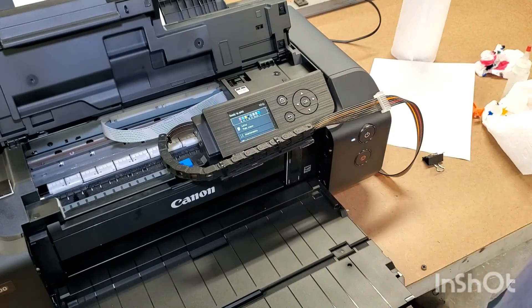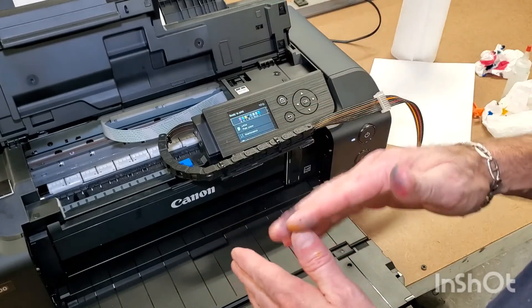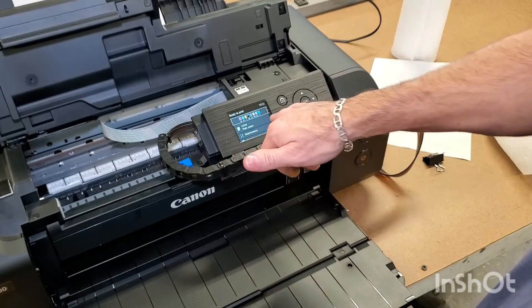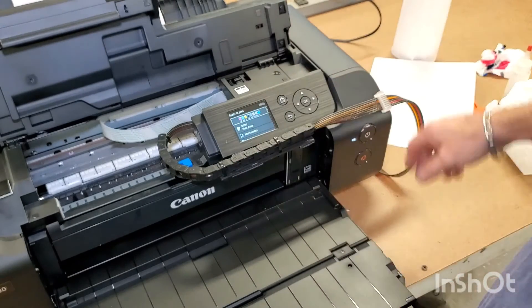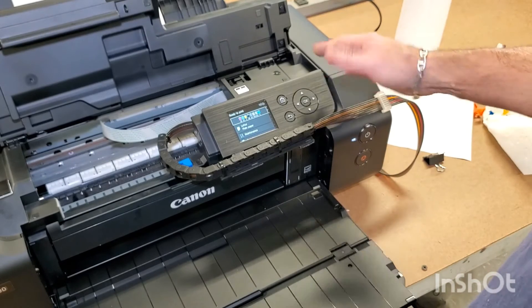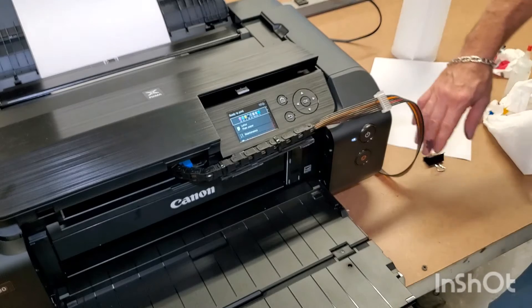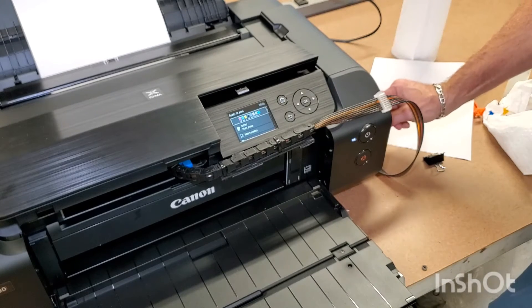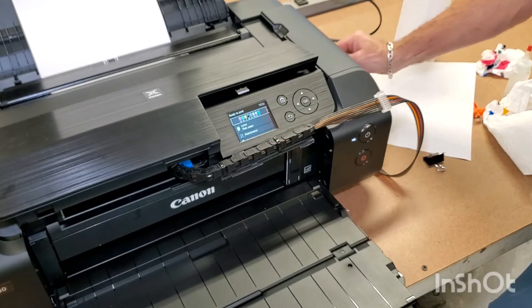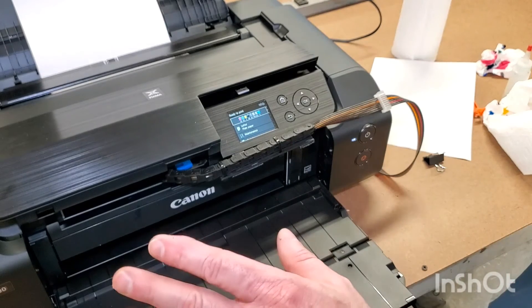There are all your colors lit up. Now, depending on when you transfer these — if you used the printer and the levels dropped, they're not going to change; they're going to stay at the same level. When a color comes up and shows depleted, you're going to hold down the stop button and you can actually shut that color off. Everything's all in — you can close this down about this far. Remember to open up all the small air plugs on the side, every one of them, only when you're printing. When you're going to fill the bottles, you plug them up, lay them down and fill them up — but that's in your instructions, so follow your instructions.